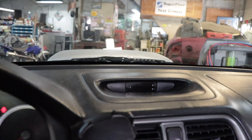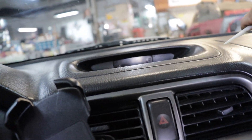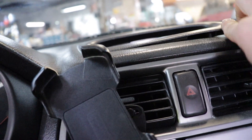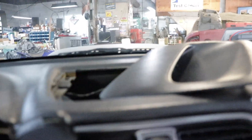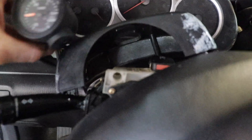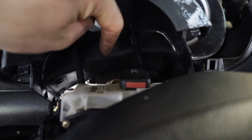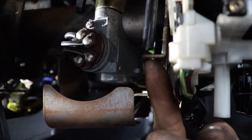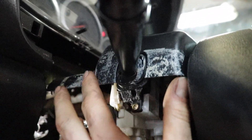So what it's going to do is replace the clock in here. This just pries up - use a plastic pry tool or a screwdriver with a rag around it to protect the trim, and just pry up on this bad boy. That just pops up, and then unplug it. I'm skipping some steps here. The boost gauge that comes on the column - you got to take that off. In order to get this stuff completely out, you see how long these stems are. They get screwed in on both sides, and the bottom cover has a single Phillips screw that goes into the hole here. Undo the Phillips, the bottom pops off - it clips together. And then the top also clips in, but you got to unscrew it there.